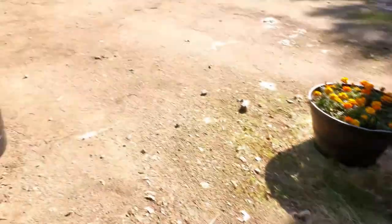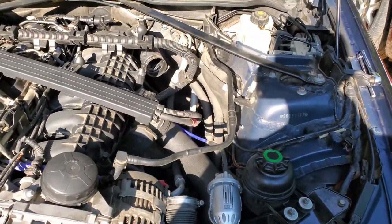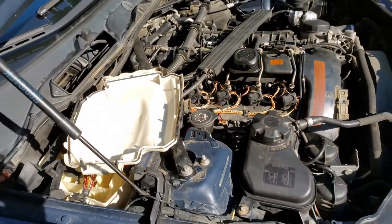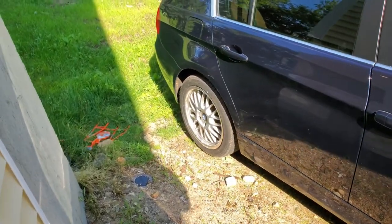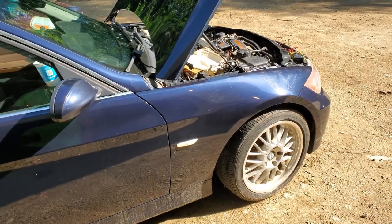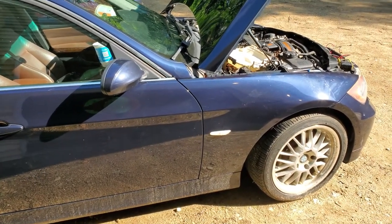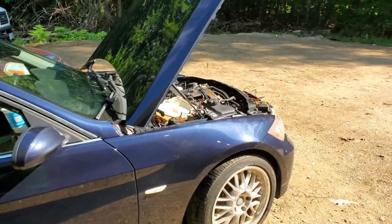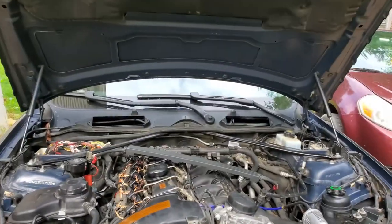Well this is fun. I've checked and I've got power all the way to the starter. The coolant looks clean so I don't think any major catastrophic fluid exchange happened. It must be something related because I got a coolant pump BSD error, I got an oil pressure fault DME, and then an IBS battery sensor fault code. I heard they're all linked on one system, so something in that system failed.